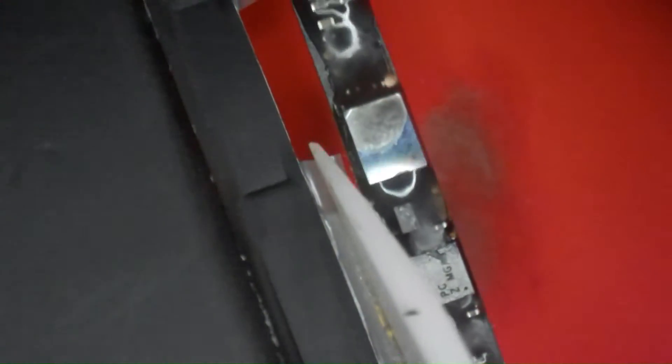Flip the battery back over to the front side and peel that adhesive straight off — you'll probably get both adhesive layers at the same time. Now the BMS is exposed and ready for severance from the cell. There are two leads coming out of the cell that need to be cut. Flip the battery over to the back side and use ceramic scissors — definitely use ceramic scissors. Reach in between the flex and the cell to sever the lead. A lot of people use long metal kitchen scissors, but if you bridge those contacts that's going to be a problem.